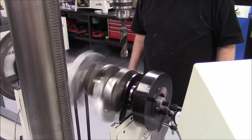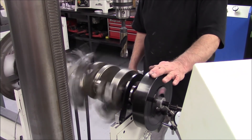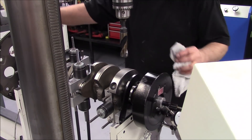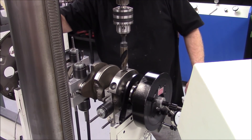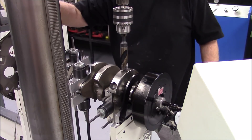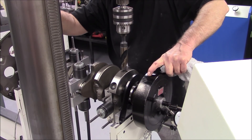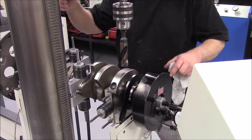We're down to 89 degrees, 9.9 grams. That's right where we want to be. Actually we could come a little more because the counterweight inside this harmonic balancer runs from here to here — we want to get in the center of that so we can take the rest of the weight out of that counterweight.